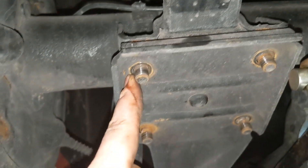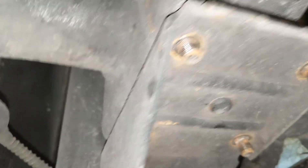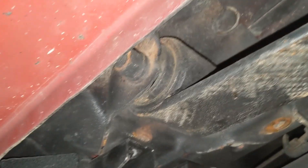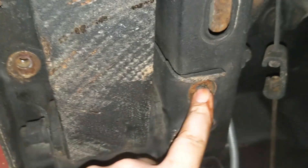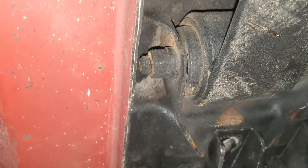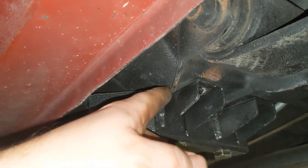Got the shackle nuts off — that took an 11/16ths. Got the four nuts off here, took a three-quarter inch wrench. Then there were three bolts which took a 9/16ths socket. I've got the subframe connectors on here but I'm hoping this will pull out from under there without having to take all those off.